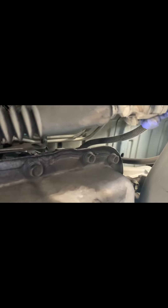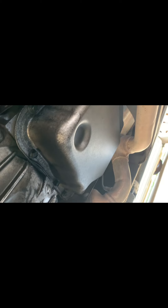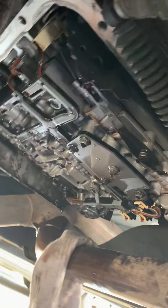To move this bracket out of your way so you can get to the bolts, there are these two bolts. They're full of crud so you have to clean them out a little, then use a T40 to drop it. I'll be unbolting it all and making a huge mess underneath here, and when I go to pry I'll record that.